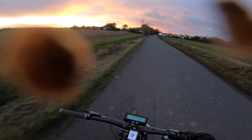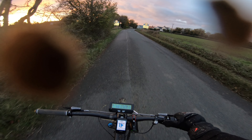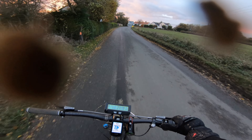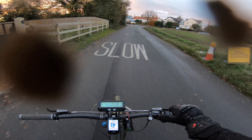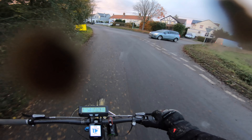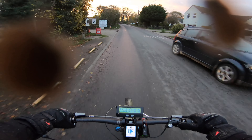When I was saying about the way this motor starts — you do have a bit of a problem with the start-up of it. It's not that bad, you can live with it. But I do want to investigate hall sensors to try and smooth that out. Adding hall sensors would also probably mean it would just flip me off the back from the word go, rather than having that power band where it comes in. I think that power band might be where it flicks over to closed loop.